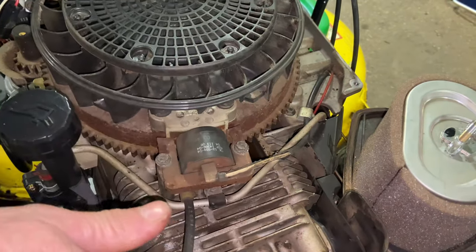You may be able to get a key at your local hardware store — I'm not sure what this size is — or you can go to the parts lookup, use your Kohler spec and model number online, and find the part number to order through Kohler. This one here is OEM coming out of the engine, so we're going to put this back in. Sometimes these are a little tricky getting in — I sanded it a little to make it easier. The half-moon side has to go in on the crankshaft, so the smooth side sits out, and that's where you put the flywheel over it.